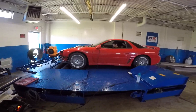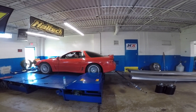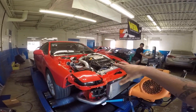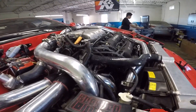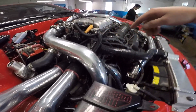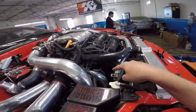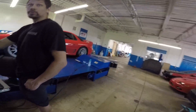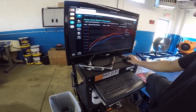Oh my god, that blow-off! Okay, I forgot - if you guys remember the street tuning video, this is the igniter plug - it came unplugged and I just put super glue on it and forgot to replace it. Well the super glue came loose and that's why the tach wasn't reading. We were thinking it had something to do with something else all day, and it was that - halfway unplugged. A minute ago the car wouldn't even start, just cranking, and I came over and seen this plug hanging off. So now I've got a zip tie on it. Real torque reading this time - instead of a trillion foot-pounds, 570 foot-pounds. There we go.